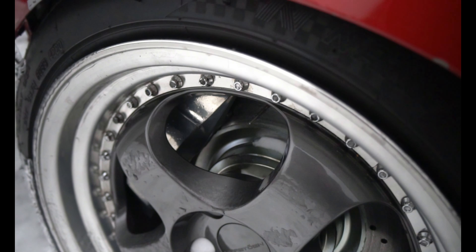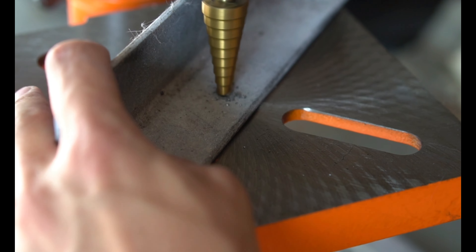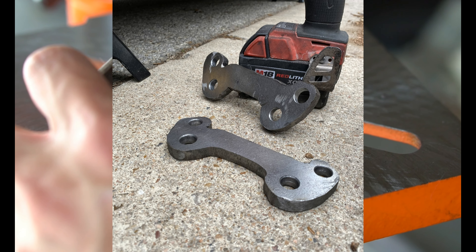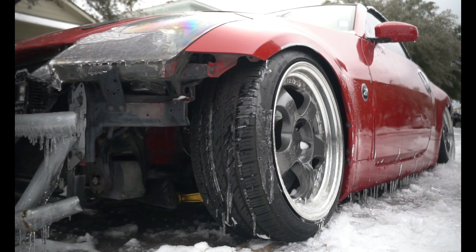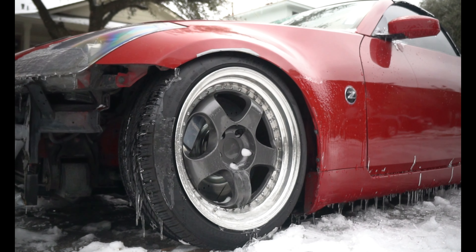You also won't have to grind away at your steering knuckle. I ended up buying a drill press to make the holes all beautiful and straight instead of using a hand drill — I bought the cheapest one off Amazon paired with a Harbor Freight step bit. No welding was required for the rear brackets, but for the fronts I had to do a bit of welding with the Harbor Freight flux core welder, which I converted into a DC welder for better penetration using a 200 amp bridge rectifier off Amazon.